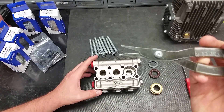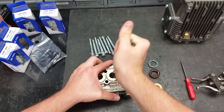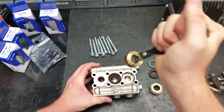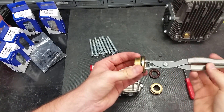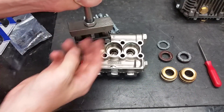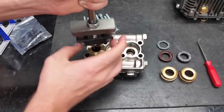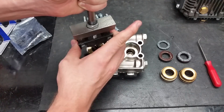To remove the guides, you can use two tools. The first is a small reversible pliers, which hooks right above the seals. The next tool is a slide hammer, which can be put in the piston hole to pull the guide out. Be careful not to scratch the pieces you are not replacing.